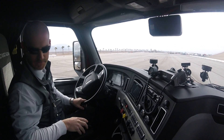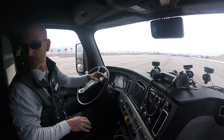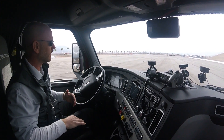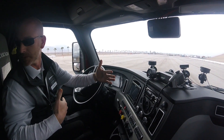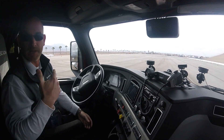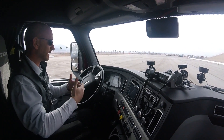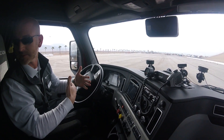If we were above a certain speed — like plus 37, 38 miles an hour — and we're able to use the camera and the radar, it affords us the ability to shorten the partial braking window and elongate the full braking window. That's how we achieve decelerating at higher speeds. It's not that we start earlier — it's that we brake more aggressively earlier in the cascade.